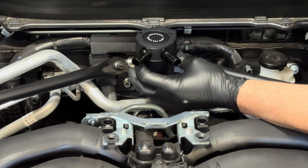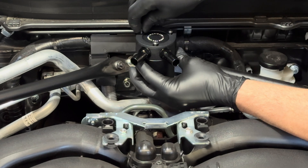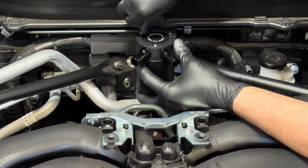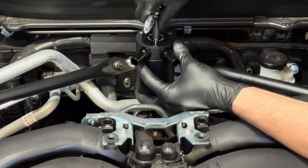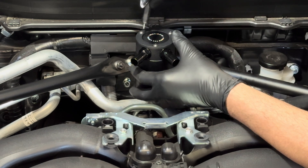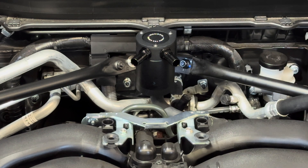Once you place the catch can into the bracket, you can see there's a little bit of movement where you can adjust it. I'm going to set it centered and get all three screws going. Once you get them on there, you don't want to torque it all the way down right away — you want to bottom all three out. It's about an eighth to a sixteenth of a turn once they are bottomed out, and that's all you need. Otherwise you're going to strip the threads and ruin the entire item.